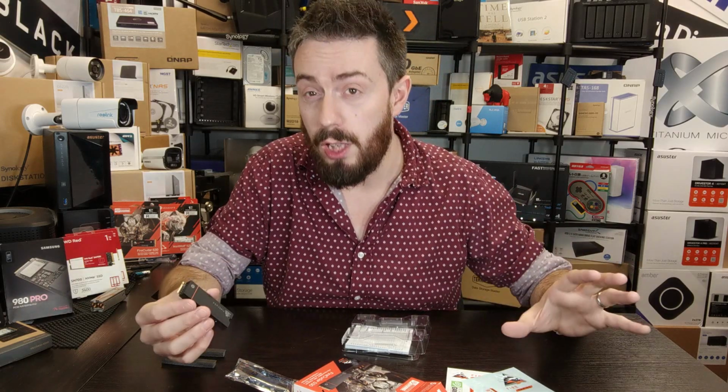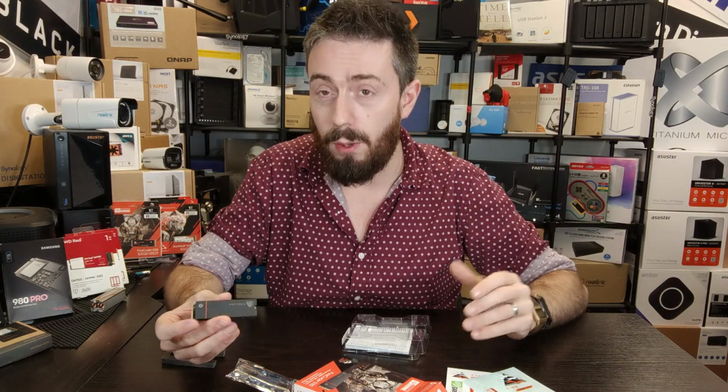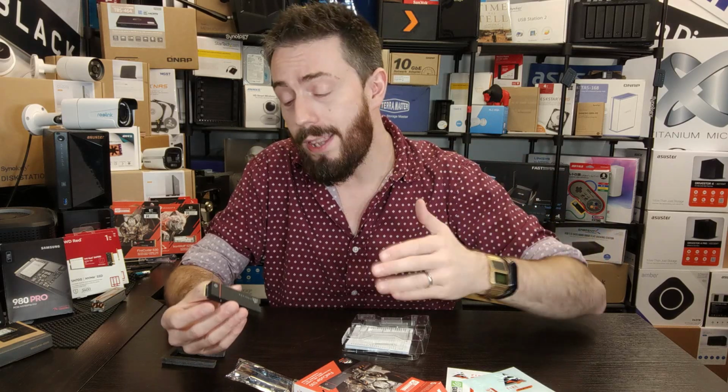I don't think that gets anywhere near the cred it should. I know a lot of gamers aren't going to do as much write activity as a number of other brands out there in the gaming world, which arrive with 0.3 drive writes per day. But that durability is about sustained life cycle. It can withstand up to 700 gig per day being written to every terabyte and still maintain optimal performance and sustainability throughout that 5-year period. That's where terabytes written and drive writes per day is utilised.